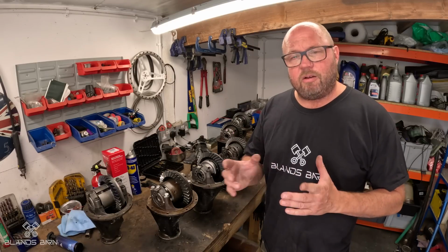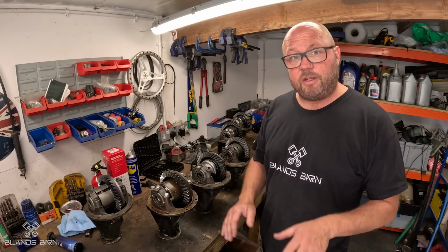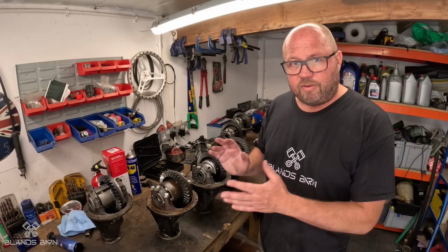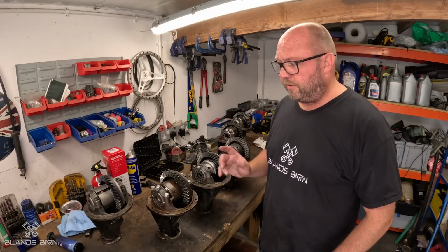The reason being, day to day the tracks will change in terms of speed, obviously weather conditions, and if there's any oil on the track, etc. Plus if you're in traffic and you need to get through the traffic a bit easier, you tend to go on the lower gear, so you've got that power. And then if you're out on your own, which is very rare, you put it into third and you can go a little bit faster and save a bit of engine wear. So there's many reasons to have multiple differentials.